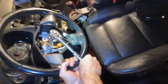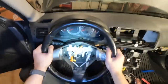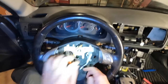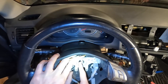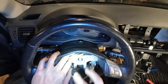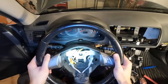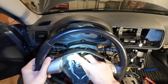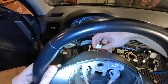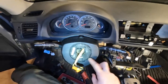This only has about 30 pounds of torque — hold the wheel and break it free. Loosen it a bit, keep the nut on there, give it a good yank just to free it up, then you can loosen it all the way. You're going to want to mark the top notch of the steering shaft in relation to the top of your steering wheel, because the clock spring is underneath and we want to keep everything in relation. You can see the splines — we want to line those up. Slide it out gently. If the clock spring rotates a little bit it's no big deal — we have our markings to slide everything back.